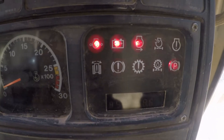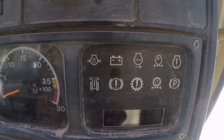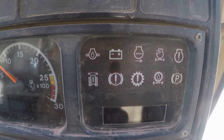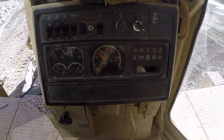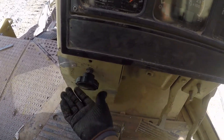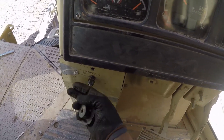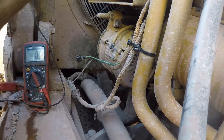Let's see what we get. As you saw, that did not fix it. We'll do a little more troubleshooting — maybe we got a breaker that got popped. That exciter wire was shorted straight to ground. See what we got going on here.